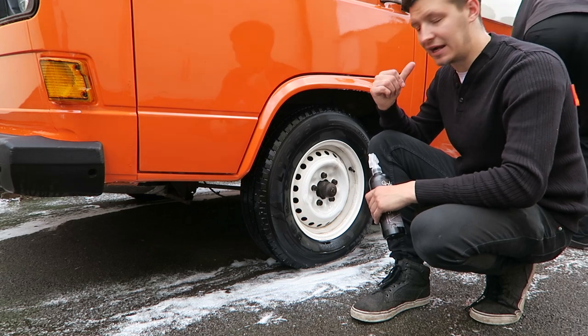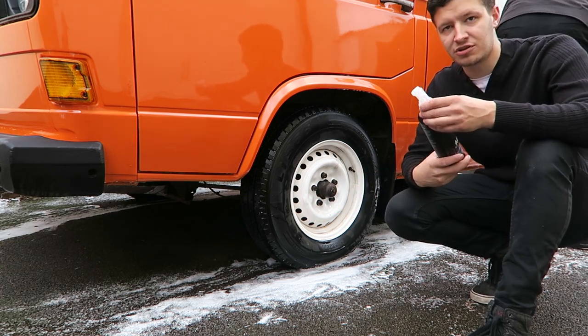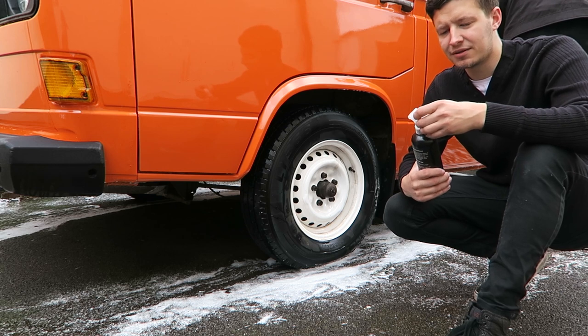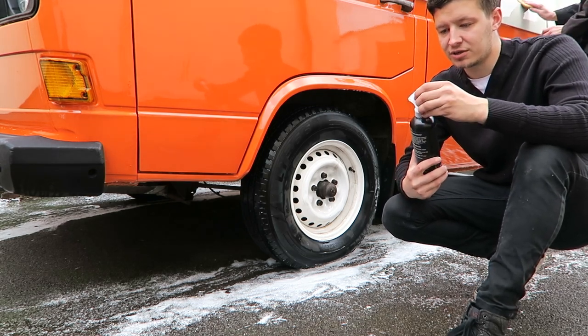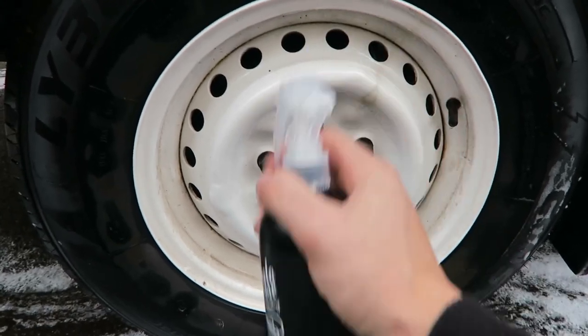It is quite easy to learn once you've done it a few times. While the wax is curing I'll show you how I clean the wheels. The wheels are still dirty with built-up brake dust. I'm going to introduce you to a product called Iron Out — an Auto Finesse product. I believe the Auto Glym equivalent is called Magma. It's a deiron-izer — any iron fragments it breaks down and turns them into a purple liquid that you can then just wipe off.